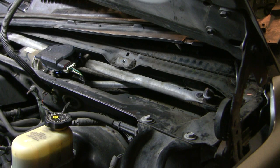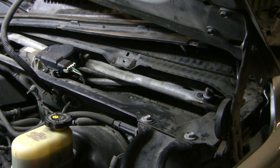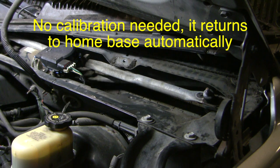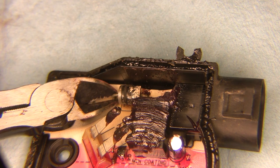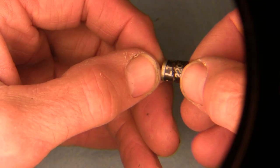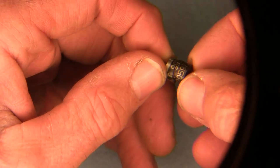Moment of truth — let's see how it works. This is low, and that wasn't working before and it's working now. Let's try intermittent — and intermittent is working too. Now that we know the new one works, let's take the old one apart and see what we can do with it. I'm going to take out this diode. I can see a little better than you can with binocular vision, but in any case the markings read LT9937, 22059733.